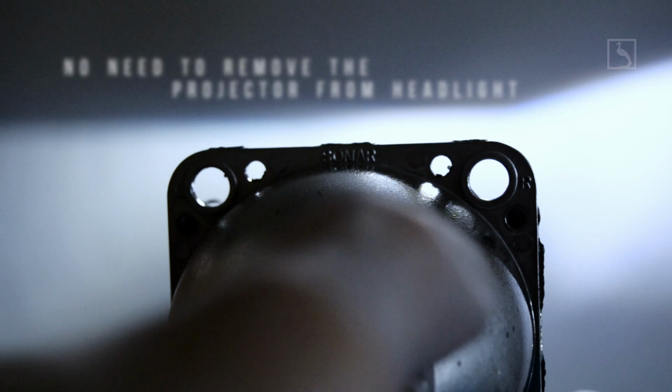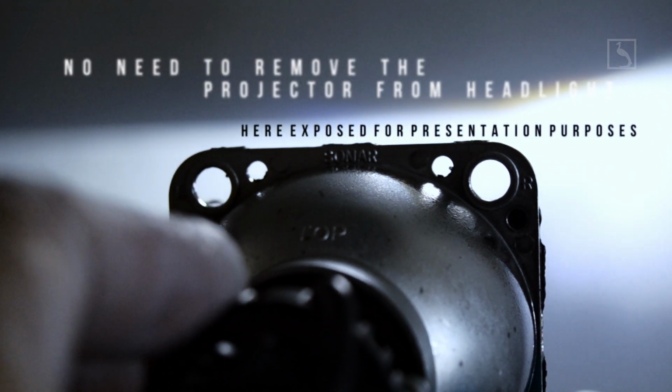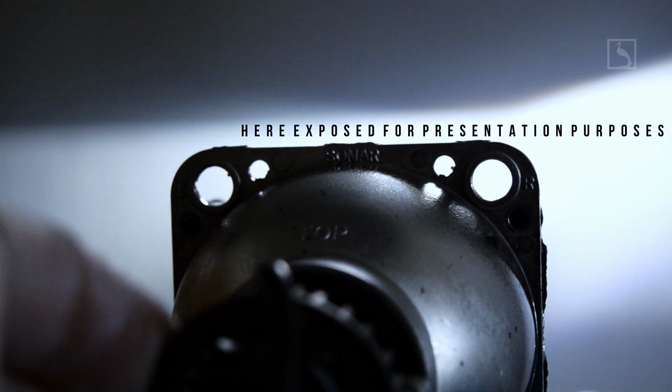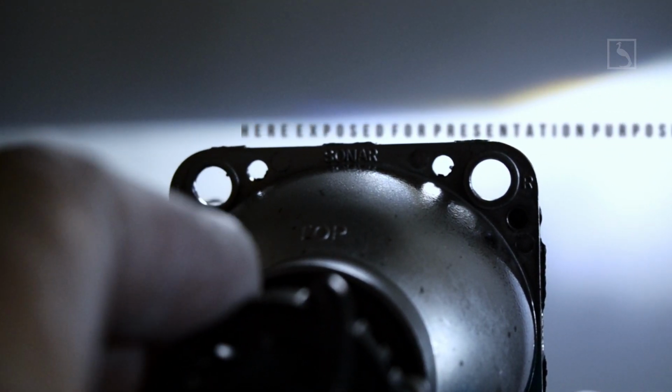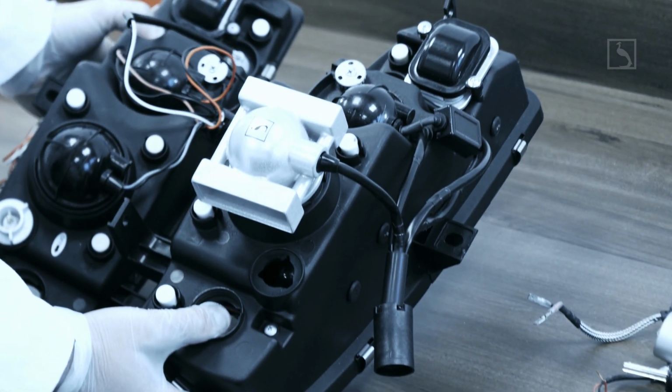As a final note, even with our LEDs, because aftermarket headlights have a very loose tolerance from one item to the other, under the same product code and same manufacturer, you must always do a 2-step verification of your LED converted headlights. First, off the car, then a final check on the vehicle. Even a 2 degree misrotated LED lamp will generate a dramatically different beam shape and light intensity profile. Let's move on to the next step.